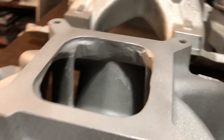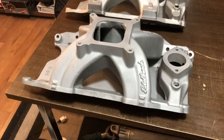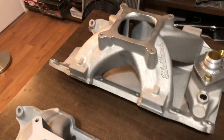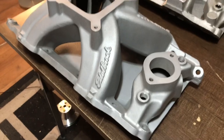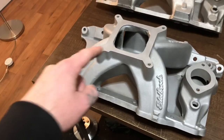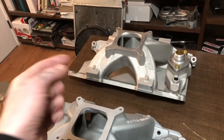However, if you look in the upper plenum, somebody has definitely gone in there with what looks like a chainsaw to do some massaging — where the stock one is smooth and round, this one is not. So this is the intake I'm going to do the port job on. It's also a little cleaner overall. This older style has no bosses for fuel injection, which I imagine is why Edelbrock switched. Other than that they are completely the same, so this is the one we're going to use, and it's already been ported a little so might as well continue. It is not for sale, but I will trade for a Trick Flow single plane.